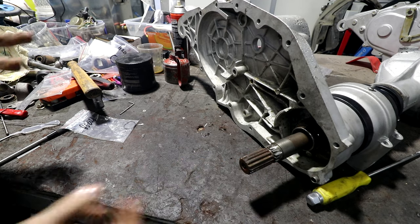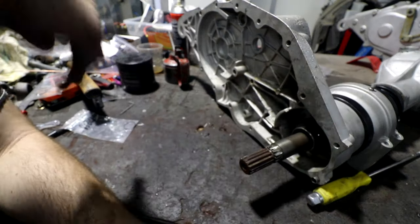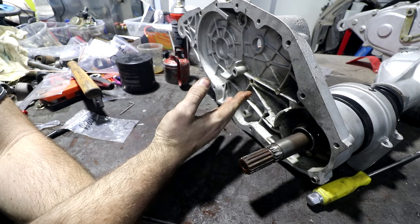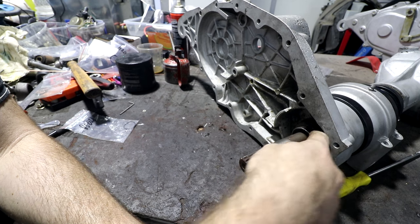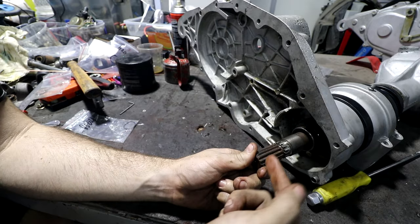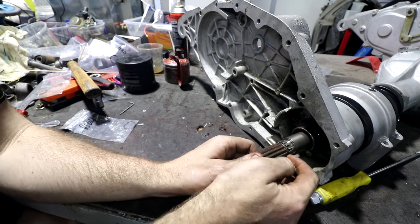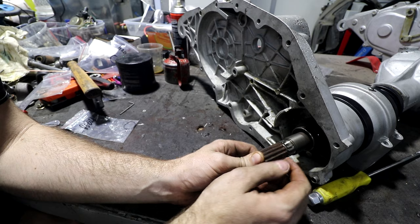This groove is for an O-ring, so on this, we have the oil in the chain case, we have the oil in the diff, which is over there. One thing that's always kind of confusing with this is it has separate oil for the chain cases and the diff. So what I would have expected is you would just fill the diff to halfway like you normally do, and the oil would just spill through these tubes and fill the chain cases and everything would just stay half full. Honda instead decided to seal the diff and the chain cases separately, so there's a seal behind here to stop oil getting into the diff, and then this O-ring that goes on here, I'll explain in a second, but it seals inside the gear on the chain case, and there's another seal that goes on here that seals the outside of the gear on the chain case.